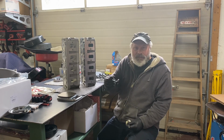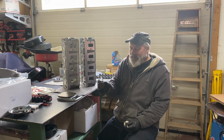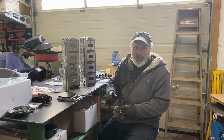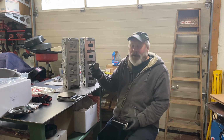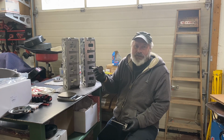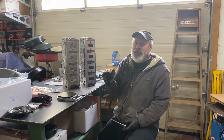Titanium valves have some drawbacks. You can't reface them because they have a coating on them. You can't even lap them in. So if the valve job is right, they fit the head, you run them until they're not usable anymore. But clearly looking at the mileage, I have 4 bags of valves now. Most of the mileage is 2,000 miles when they were replaced. So the engine was probably rebuilt at least one time, and they didn't replace the valves.